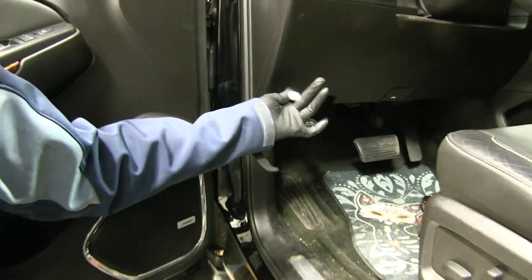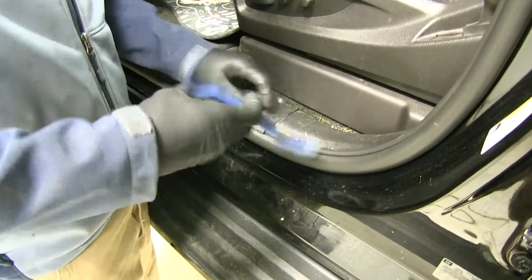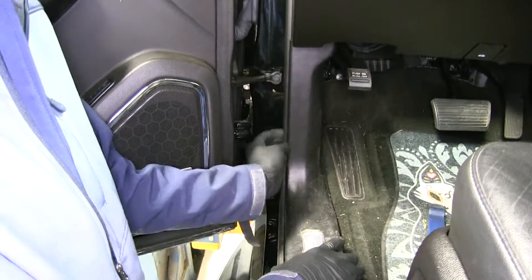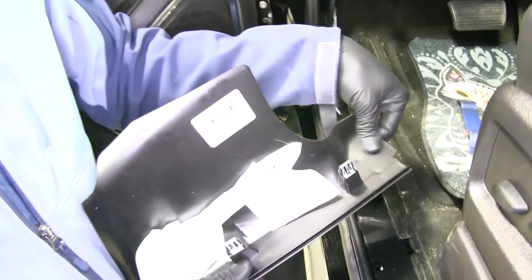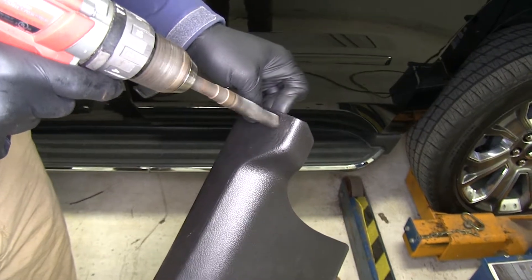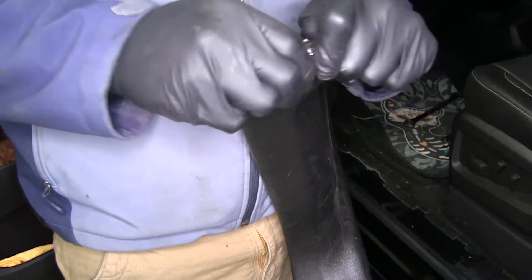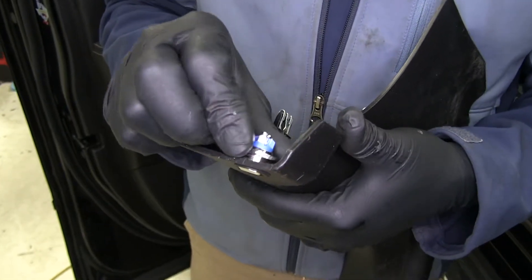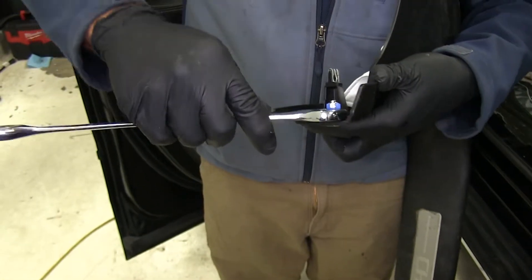It'll definitely be out of the way so it won't easily be bumped. To get to that area we're going to start popping this panel up — working forward then pulling straight back. A trim panel tool or a small screwdriver should be what you need, just start working forward releasing the clips. Once we've released the last clip it's pretty much a straight back pull and that'll come off. Now we're going to use a 5/8 inch hole saw or drill bit to get that drilled out. With our hole drilled we'll place our switch in there — it may be a little stubborn so twist it in. Once it's flush with the surface, take the nut, thread it on the back, and snug it up using a 19 millimeter or three-quarter inch socket.